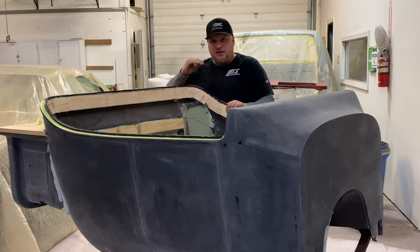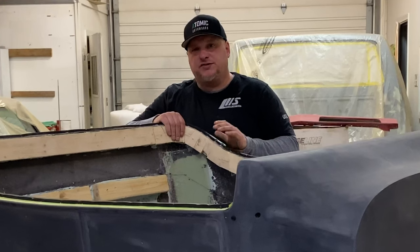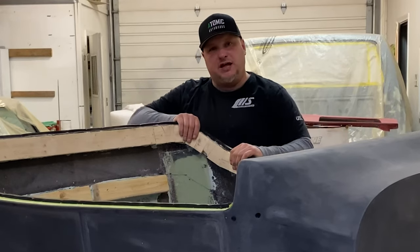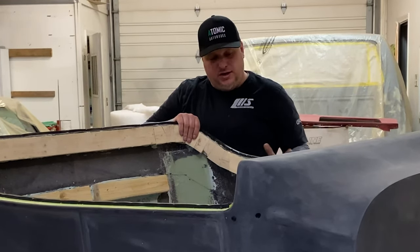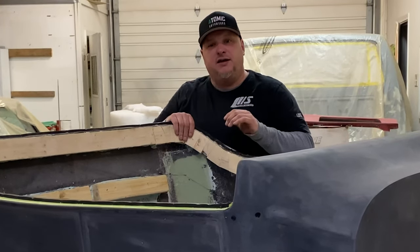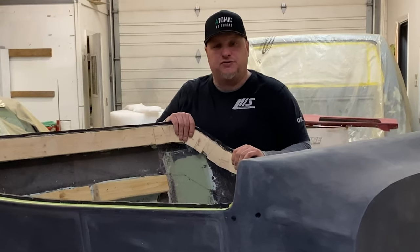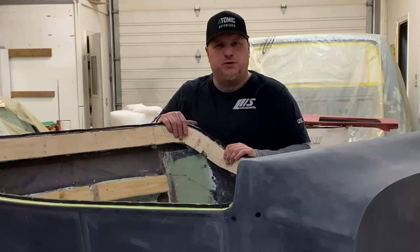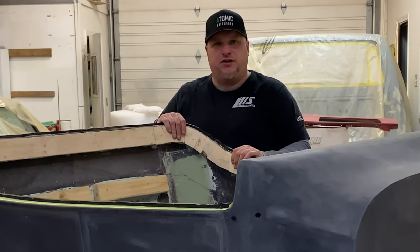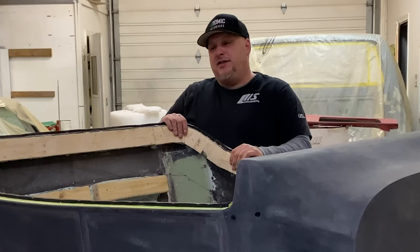I'm going to tell you some dirty little secrets nobody wants to talk about. When you put this wood in, you actually use body filler to bond it. The secret is to use a really high-quality body filler. On the back of the wood you clamp it to the body, but make sure you have another piece of wood on the outside so you're not clamping directly to the body — otherwise you'll suck the body in and it'll dry warped. That bond is incredibly strong; you will literally rip the fiberglass apart trying to remove the wood. Most of these bodies use polyester resin, and body fillers are typically polyester-based with the same hardeners — body filler just has extra powders to make it thicker and more workable.